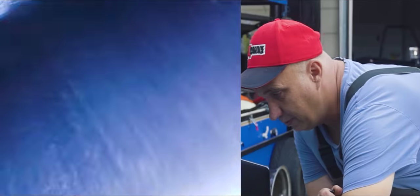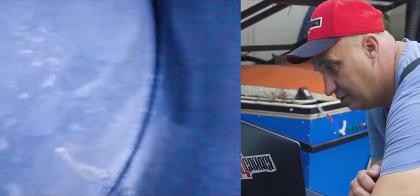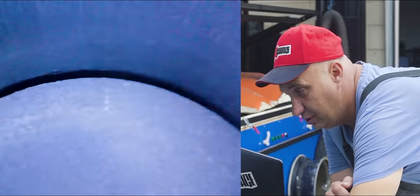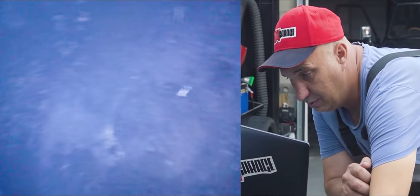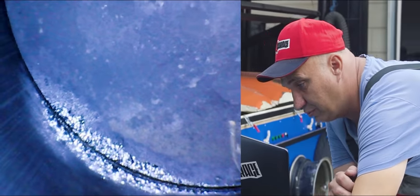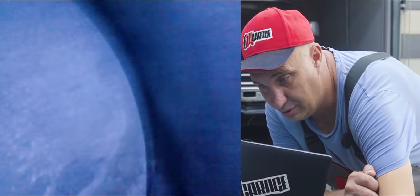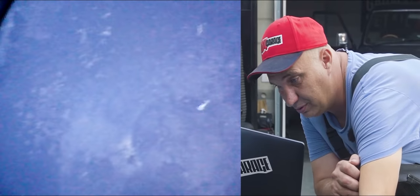The camera is on. Let's insert it — turn it slightly. There's the piston. Looks like a normal piston to me. There are some deposits, but that's totally normal. Though there is a pretty big gap between it and the cylinder wall. Overall the piston seems to be fine — nothing horrifying to report. I do see a tiny bit of oil, but that's not a problem. Our main task is to make a few marks. I do see a scratch — must be from when I stuck a screwdriver in there.